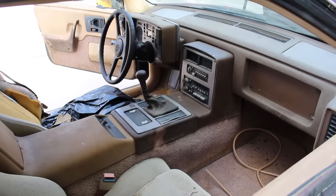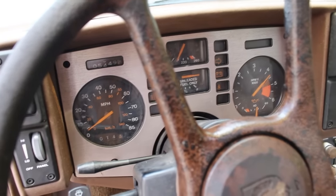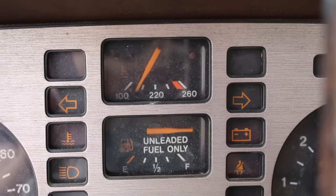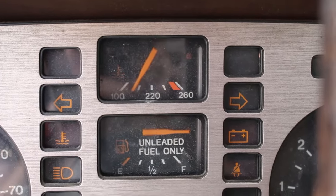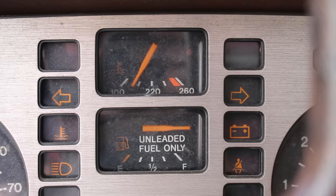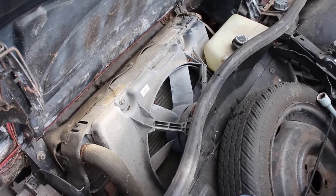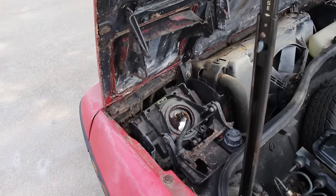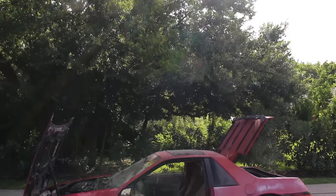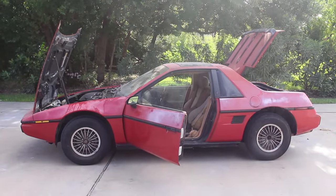Inside the car, there were some problems. We had the oil pressure gauge, speedometer, and odometer working, but that's about it. We already know the fuel gauge is never going to work, at least with the current sender that is rusted through in the tank. The tach is reading a constant 4000 RPM and the coolant gauge isn't moving at all, even after running the car for quite a while. This concerns me since I don't know how well the car is being cooled, especially since the radiator fan isn't coming on — that right there is a big issue. There's also the fact that the headlights aren't popping up, so night driving isn't a possibility. However, the car does drive after all these years. Taking care of all those issues is what's coming next. So until next time, I'll see you guys later.